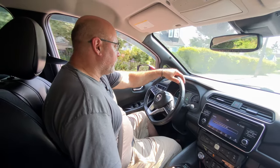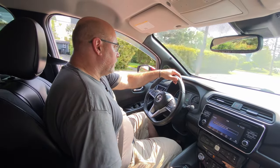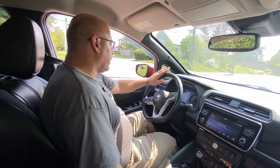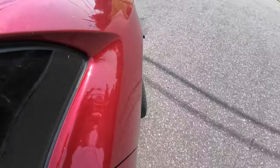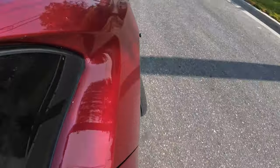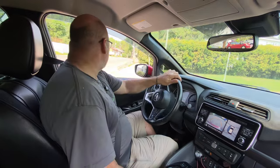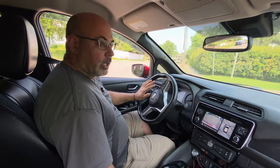Let's try this again. This time I'm going to accelerate and then put the car into neutral, and listen to what happens. Very little noise there, because in this case neither of the axles was being driven. And clearly this CV joint is very loud. Also notice in reverse it's not so bad.